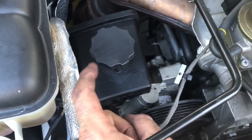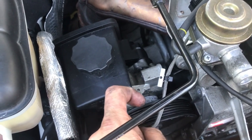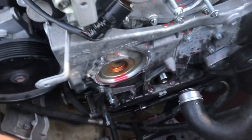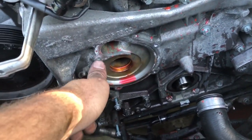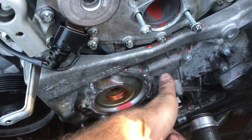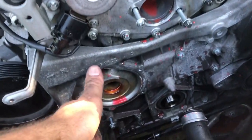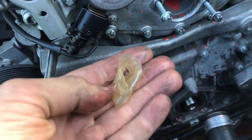It turns out there's one bolt that goes through here that you can access with it in place. I almost took it off before I realized there's two bolts underneath, and that comes off with a couple of these little wire things. Then a bunch of bolts for the water pump. When I took this off I stuck my finger in there and could feel the seal that seals the timing case to the block, and that felt okay.